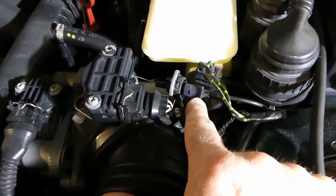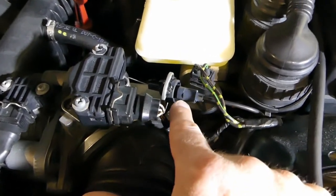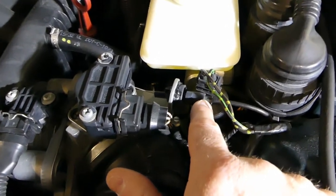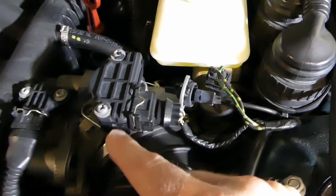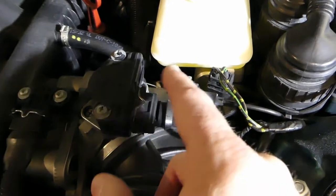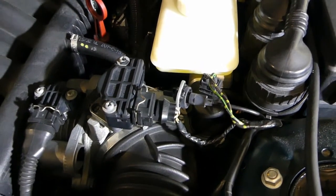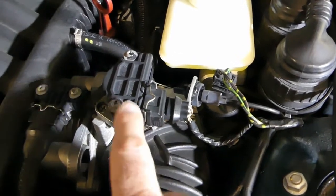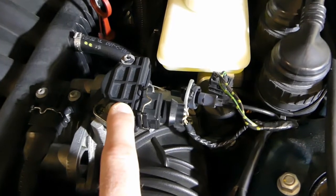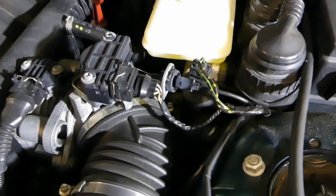With 20 years on the car, that plastic just broke — I presume it broke when we did the engine overhaul, so we never replaced the cable. Now the cable is loose, and because of heat — we're now in June — whatever adhesive was used to help secure it has loosened up. When the actuator pulls the cable it doesn't completely sweep the throttle body, and the position sensor up here recognizes that and indicates a fault. My goal today is to replace that cable.